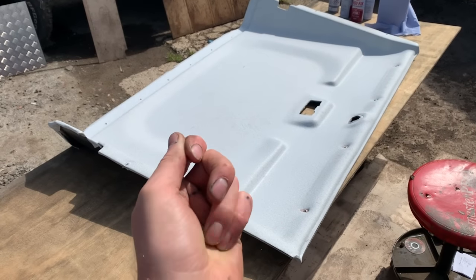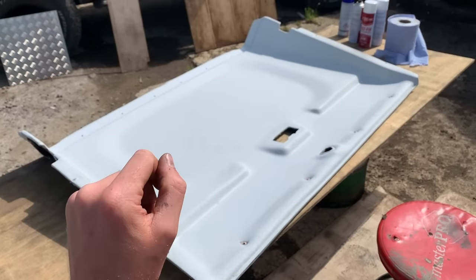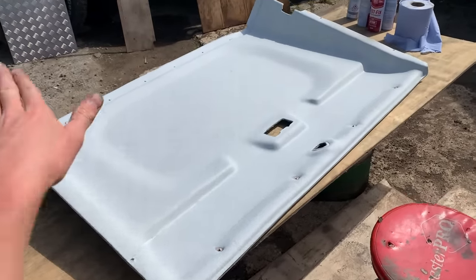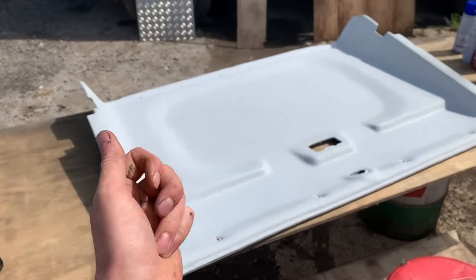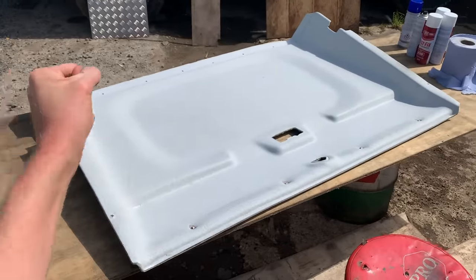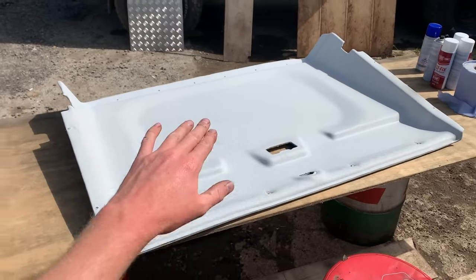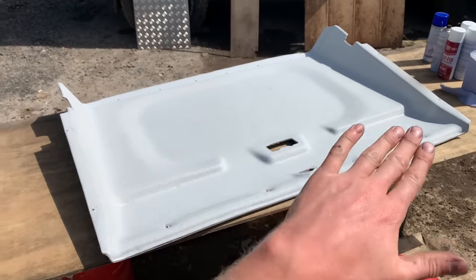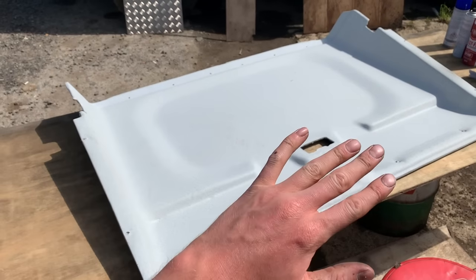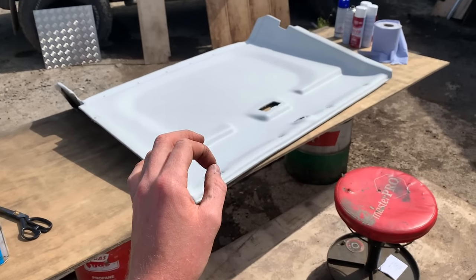The way Land Rover manufactured this is a PVC skin and then compressed fibers, compressed into a mold at high temperature. If I peel off the PVC, what tends to happen is you get an uneven area where it rips up the fiber, and when the suede goes on top, yes, you have a better bond, but you see the distortion on the fabric.